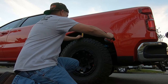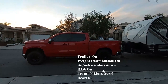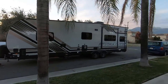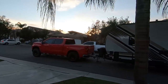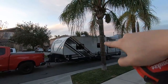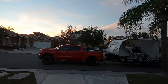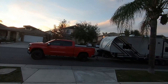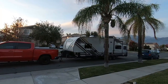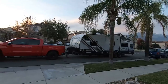After adjusting, we're right at six inches in the rear and about nine inches and two lines in the front — we lowered the front and lifted the rear. Look how much more balanced the truck and trailer look now. This trailer is already too big for this truck, it's pretty level, there's not a lot of weight in the back, and it's still really impressive results. The gross combined weight rating on the 1500 is 15,000 pounds and we're at 15,940, so we're slightly over.